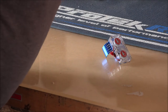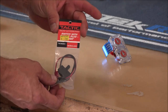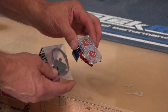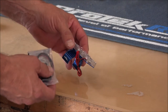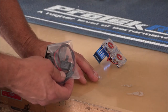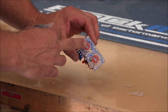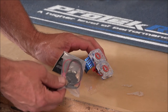I also bought a switch — got this from my local hobby shop as well, $7.99, made by Tactic. All this is is an on/off switch that connects to my receiver and then to my cooling fan. That way I don't have to open up the receiver box if I ever want to turn my cooling fan off — like in wintertime when it's just not necessary. All I have to do is mount the switch somewhere, flick it, and turn my fan on and off whenever I want. I'm not concerned about power draw; I'm concerned about the lifespan on these fans — if they don't need to be running in cool temperatures, I can just turn it off with this switch.